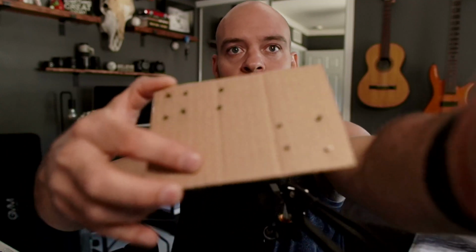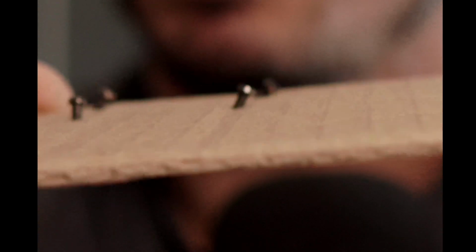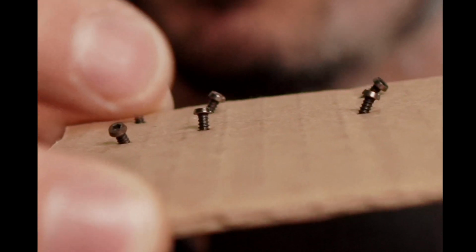I've got one of those cell phone screen fixer kits, and I'm using this little guy, which is kind of like a little spreader, and they also give you these other little spreaders, which are super helpful. The other thing is that these screws are really small, so I set up a piece of cardboard, and you keep all of the screws pegged into that cardboard so you know where they go at the end of the day. Let me get myself back in focus here. There it is. It's a super helpful way to manage the screws. You just stick them back in that cardboard setup, which is really helpful.